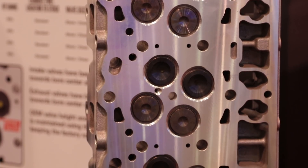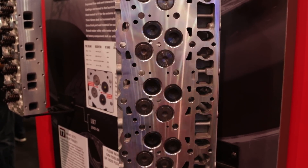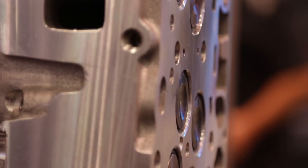Let's talk about the performance capabilities of this head. It's a bolt-on part with all the advantages of your technology and R&D. Where there is some power, there is always more power to be made. Duramaxes are popular in racing. This cylinder head — we've made it a lot stronger. The deck, for instance, is 16 millimeters thick, a lot thicker than the original. We took the valve cover valley roof and raised that up. All the springs and everything else are in the same location, but by raising the roof, we've increased the water and cooling capability on the cylinder head. We also have slightly larger valves than stock, and we've moved the valve heads in slightly — the valve tips are in the same location, but the valve heads are moved in to increase swirl effect and flow.